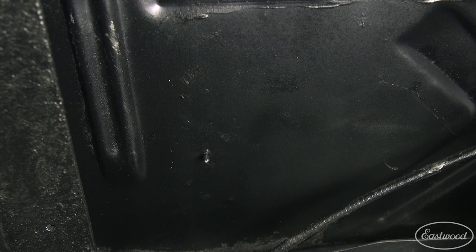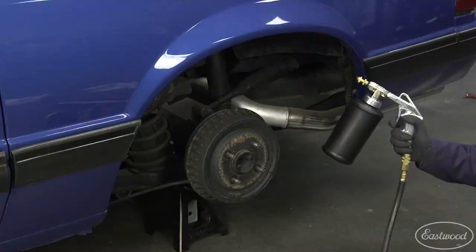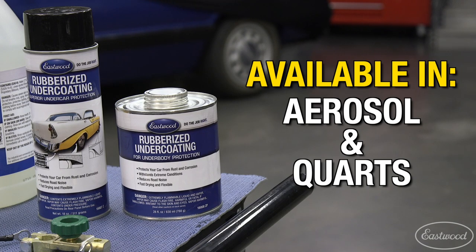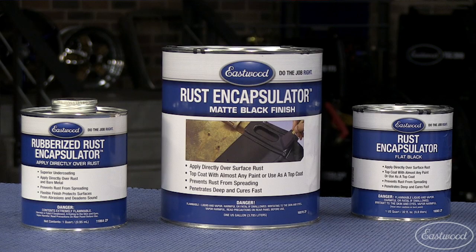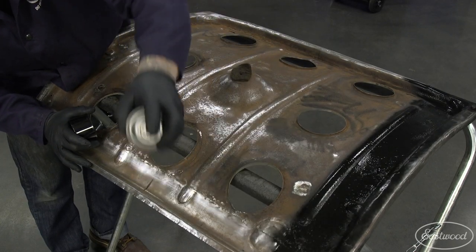The underside of your vehicle is one of the most important places to protect as we go into winter. Starting with the rubberized undercoating, you'll want to coat areas such as wheel wells, since these take all the abuse from everything tires can throw at them — from stones to any debris in the road. Available in either aerosol or quart, it ensures you can easily apply as you wish in the quantity you desire. Any areas which may have been chipped down to bare metal and have begun to rust are perfect for our next product, the Eastwood Rust Encapsulator.